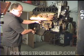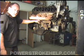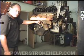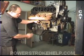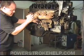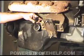If you lose this piece down inside there, you're going to have to pull the motor out of the truck. You do not, under any circumstances, want to do that. If you have a hold of it properly, you can remove the ring, replace the O-ring, put the ring back on, and it's a relatively painless thing.